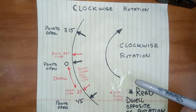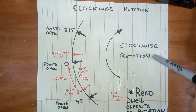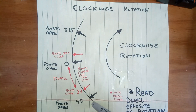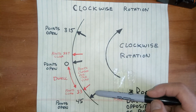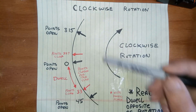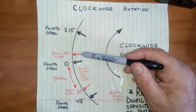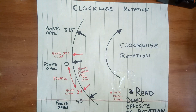It's as simple as that. Either look for the widest section, or the simple way to remember it is: whatever direction the distributor is turning, you'll read the dwell in the opposite direction. You set it up normal. You can tell easily whether you're in normal or dwell flash, because dwell flash has twice as many flashes — it flashes when the points open up, which would be normal, and also flashes when the points close again. It's very convenient, and you can see every lobe of the distributor going around the whole side.